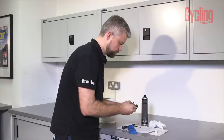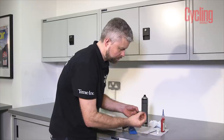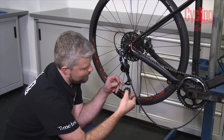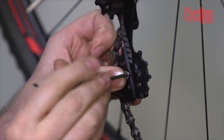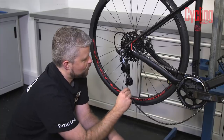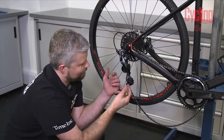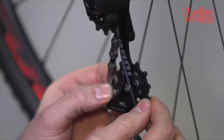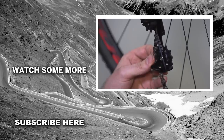With the spacers in place, pop a little Loctite onto the bolt threads and refit it into the derailleur cage. Check the orientation of the jockey wheel before you fit it — we have our L marking facing out for the lower position. Tighten the bolt back up; the torque setting for this is 3 newton meters if you've got a torque wrench. After you've done the top jockey wheel, make sure that it is still at 3 newton meters, because if you move the cage that could loosen the bolt. When your chain's sitting on the jockey wheel — this is a narrow-wide jockey wheel at the bottom, it isn't at the top on this Force mech — just make sure that the chain is sitting correctly on the narrow male links and the wider female links.